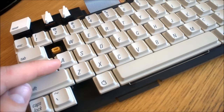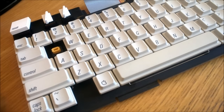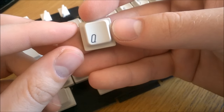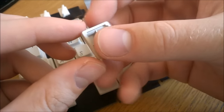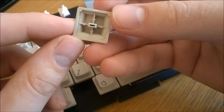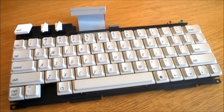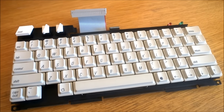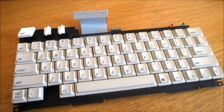The caps are also pretty nice. They look a bit weird, and they have that impossibly ugly font in italics in the bottom corner of the keycap, but they're made with high quality dye sublimed printing. And the keycaps themselves are made out of PBT, which doesn't yellow with age, and look at how thick these are, they're massive. By the way, although the key tops have a cylindrical profile, the caps aren't sculpted, which means that the keycaps aren't angled.